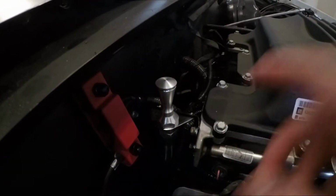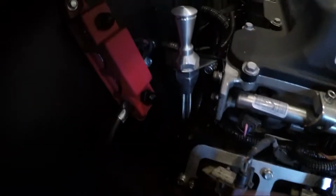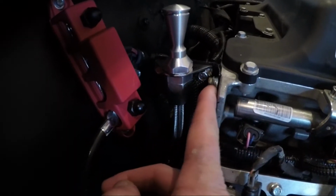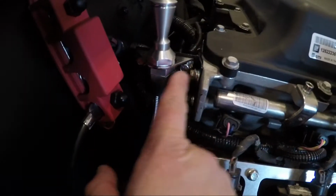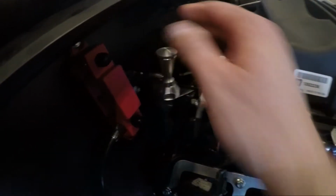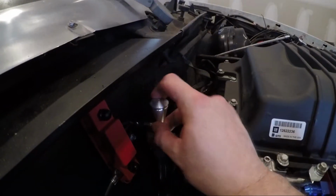Okay, YouTubers, so here's the bracket installed. I apologize, the lighting isn't that great in here. All it is, I painted it. First, you saw what you saw me cutting earlier, bent the sheet metal. I leave a little bit of support on this side. Bent it inside my vise, painted it, screwed it into the back of the supercharger, and then bolted it down here. It's extremely sturdy. It's down inside the transmission, mounted very easily. Easy access to the dipstick.